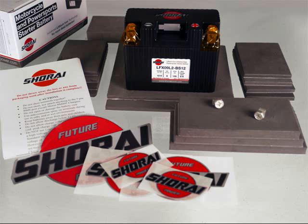First, don't throw away the box or any of the foam packaging until after installation is complete. Please also be sure to read the included user's guide for cautions and information on care and charging. You'll need a 10mm wrench or a number 3 Phillips screwdriver to install the LFX battery, possibly scissors, and whatever tools are needed to remove and reinstall bodywork and to access the battery box.